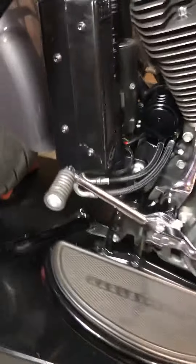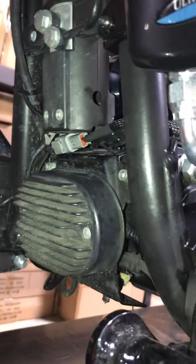On this Softail, I mounted it and took all the wiring under the ABS right here. Yeah, try to get it all clean, so it's all tucked away so you don't really see it. On the Softail we need to run the wiring down the right-hand side, so we come down like this along the frame.